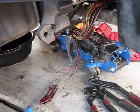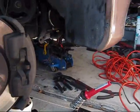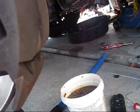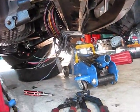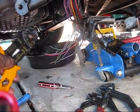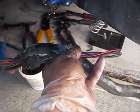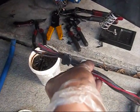The next thing that I'm doing, I'm resoldering all the wires because the compressor ripped 8 wires. I have to resolder them back. Not very easy to solder. 8 broken. I will use the solder kit, some flux, and solder, after I strip the ends right there. To do a better color match while resoldering the wire harness, I took the same color wires from the junker, so I will be able to solder exactly each color that I need.